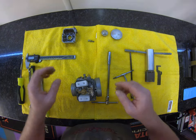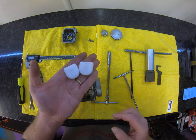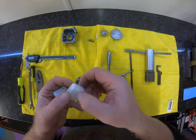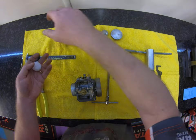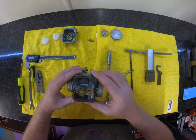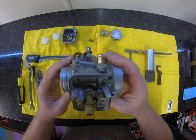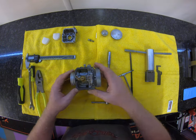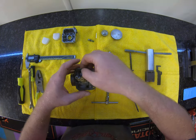Look inside, check that we're good, no cracks in there. Floats now — if you take out one of these floats and it's got some petrol inside, there's nothing you can do, so just throw that away. That leaves you with the innards of what you can see inside the carb. Let's be careful and take off the gasket.